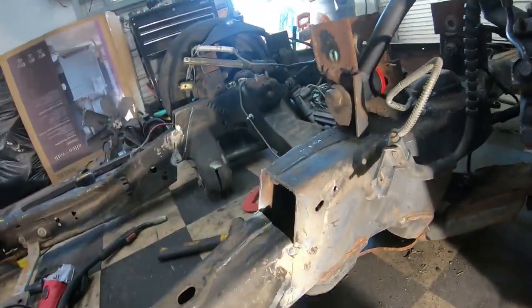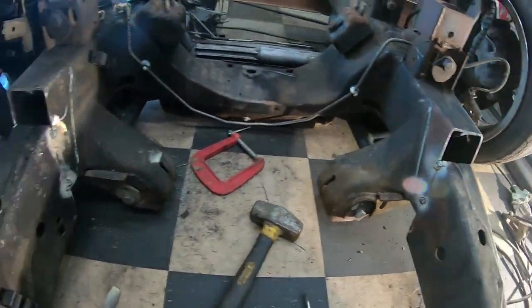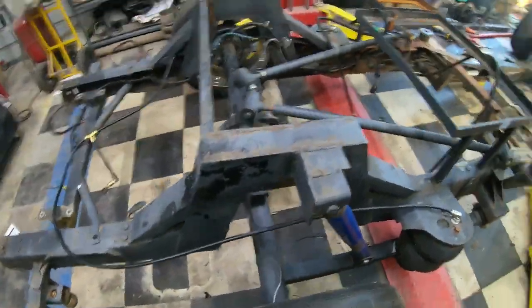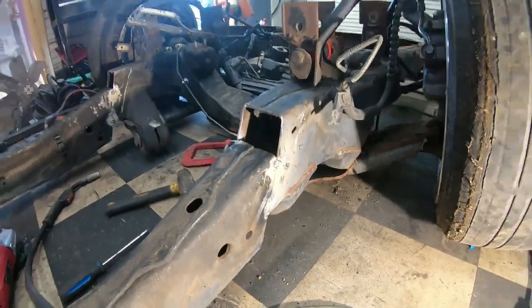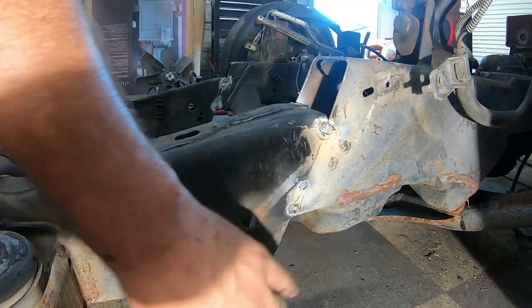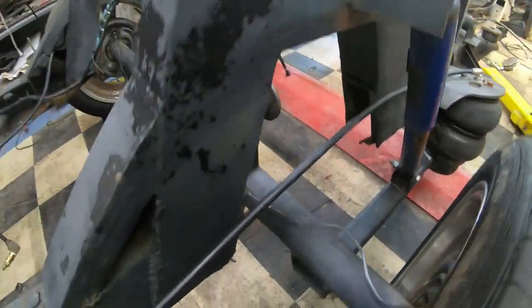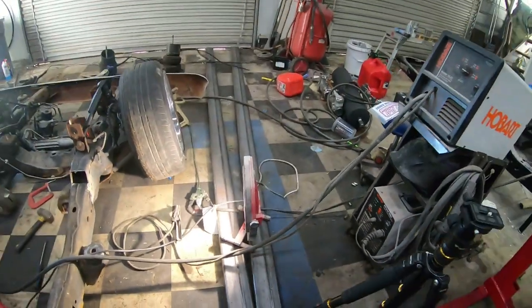I've got it just tacked into place — you can see right there. Currently the back is raised up, which is why you see the front sitting down. I'm going to make some brackets to go from right here down, angle it up, and support it there, and one on the bottom as well, then clean it all up. I'm going to cut the whole back section off right here — as you can tell, somebody else did it and it just looks terrible. I'll use that steel on the floor along with some two-by-four stock and rebuild the whole rear section of the chassis.